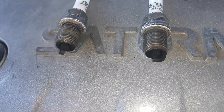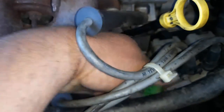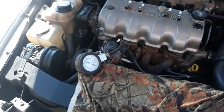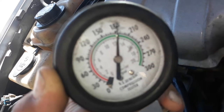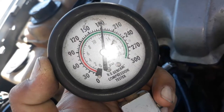Black means fuel — I'll double check before I post this video. What I did was I disconnected the ignition coil so we don't spark at the wires. I removed all the plugs out of your block. I got this compression tester here plugged into the number one cylinder, and we're going to write the compression readings on the whiteboard. We cranked it over — I let it do 10 rotations. The result for cylinder 1: you got 180 pounds. We're gonna go write that on the whiteboard.